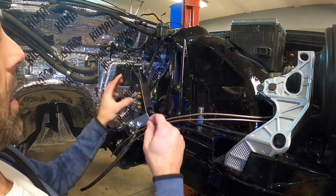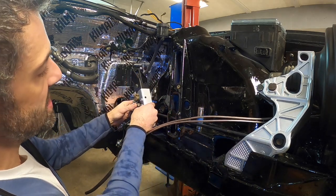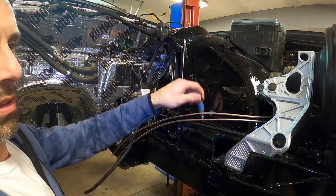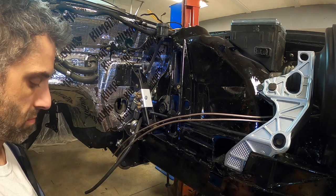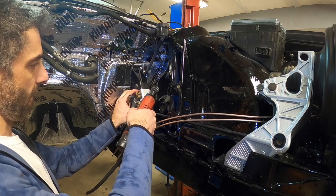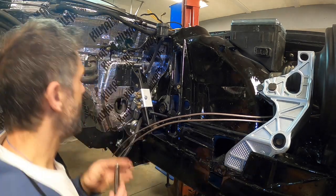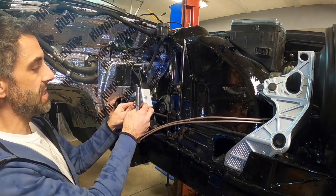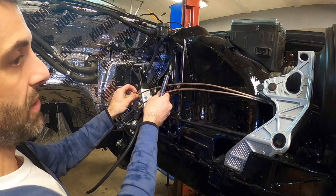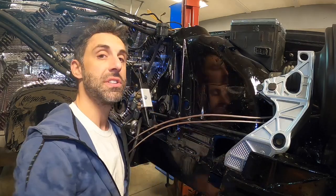So we've got our rear adjuster bracket completed, and the way that this works is it essentially just sits right on here and it screws right in there like that. And from there, the other two get installed directly onto the exposed nuts. And that holds everything in place for the two lines to go straight down into. So what we've got to do now is size and terminate our two brake lines that go to the two rear tires.